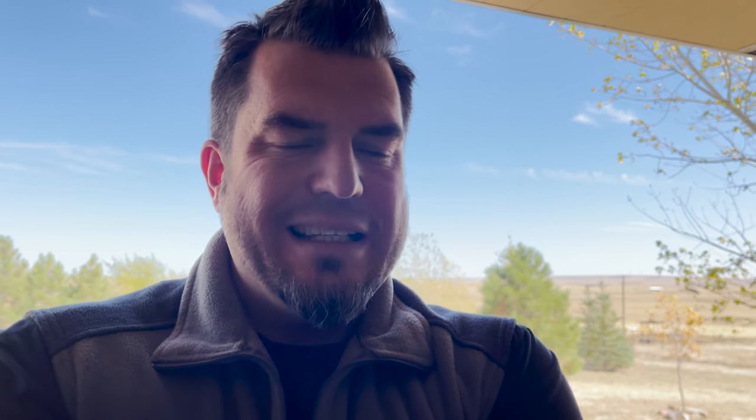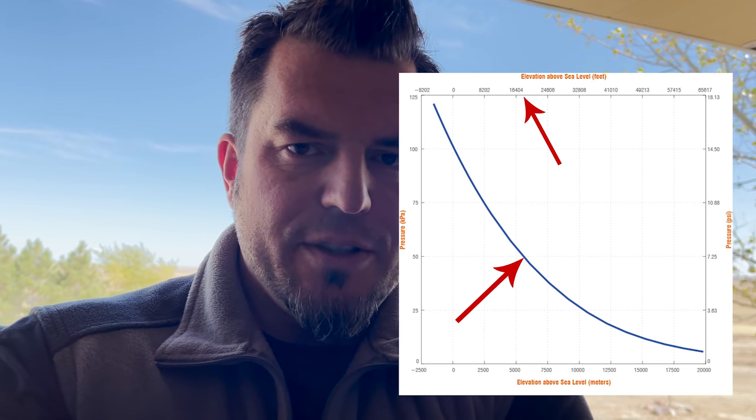Hence having a wastegate — you have to vent it at a certain point. But when you go up super high, your engine effectively becomes much smaller. At 18,000 feet, we have roughly half the oxygen available, so your engine is roughly half as big at that altitude. There comes a point where you may not be able to re-light that turbo — if you pulled the power back and put it to it again, it would never spool back up and make boost. It's kind of like having a flame-out.